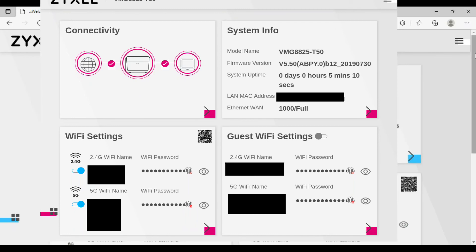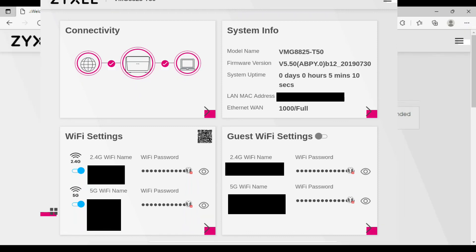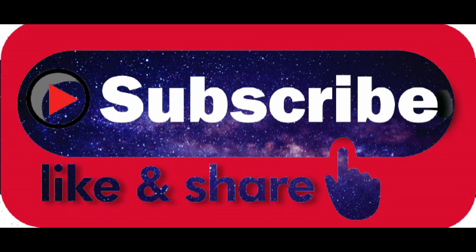For the channel, you can set it to Auto, or you can install a Wi-Fi analyzer program to check which channels people in your area are using too much — those are busy. Then select a free channel, like I set channel 7. Choosing a less busy channel will give you better speed. I hope you understood everything. If you have questions, ask in the comments, please subscribe to the channel and share with others. See you next time, bye bye!